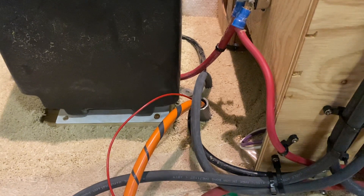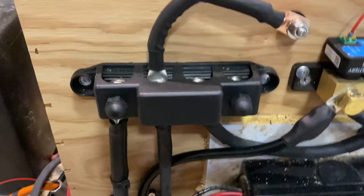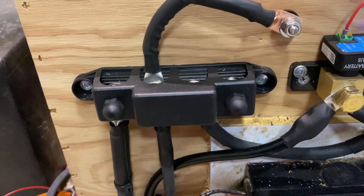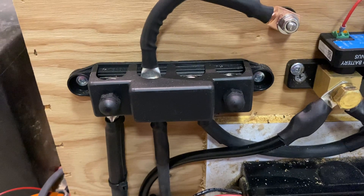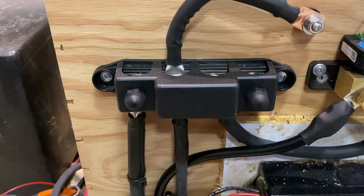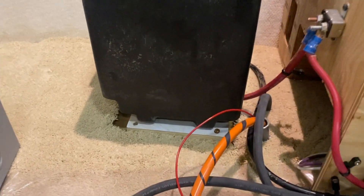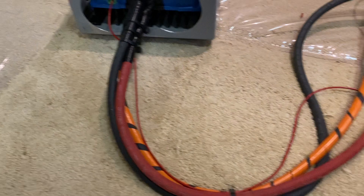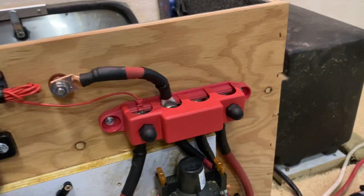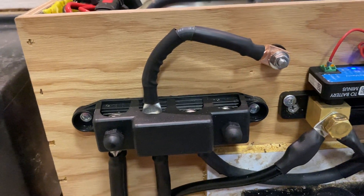As previously mentioned, there is a ground wire going to the vehicle ground and a hot wire going to the charging system. The ground wire goes up to this bus bar — because with the non-isolated charger, the grounds of the vehicle and the RV are tied together right here at the bus bar. From there another wire comes back out and goes to the charger. The yellow-wrapped wire comes from the vehicle into the DC to DC charger, and then that red wire comes back out and hooks to the positive bus of the DC system of the RV.